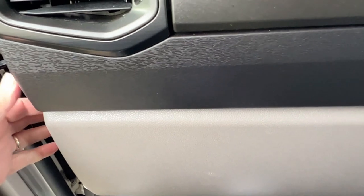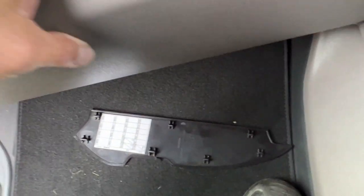And if I can show you, these are little places where you can put your fingers and you'll be prizing in there, so you just pull down and work your way along. It feels like you're breaking the cover, and I don't know why manufacturers do it like this. You'll need the door open a little bit - get your fingers round - and these little toggles just release all the way around.